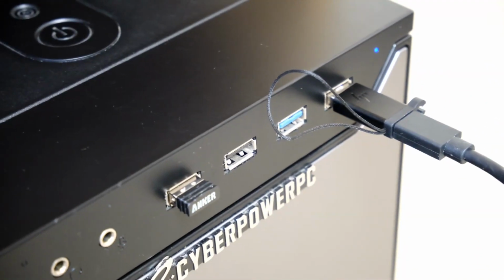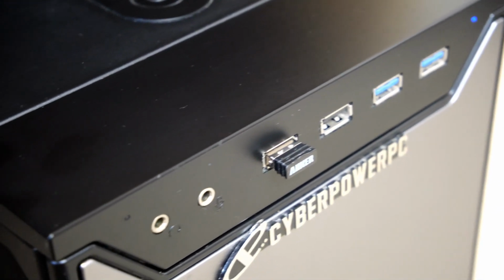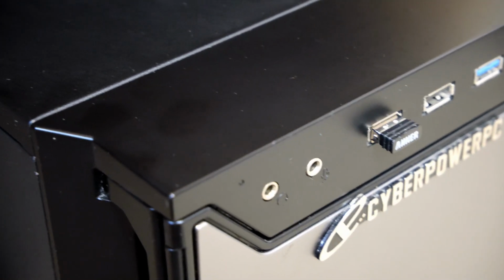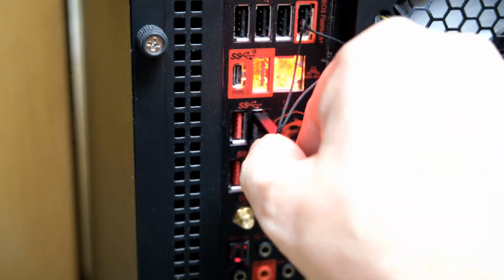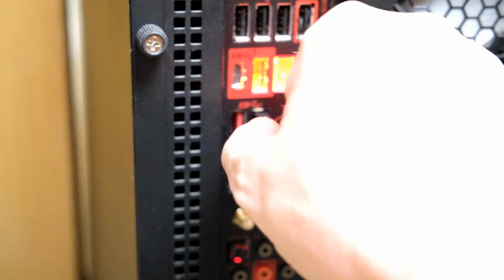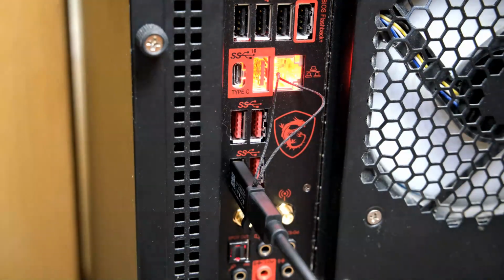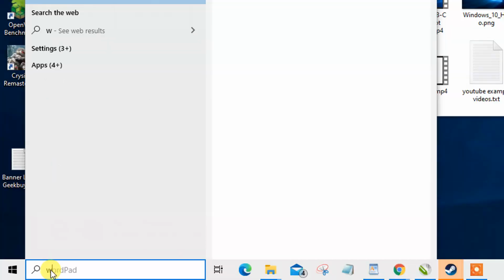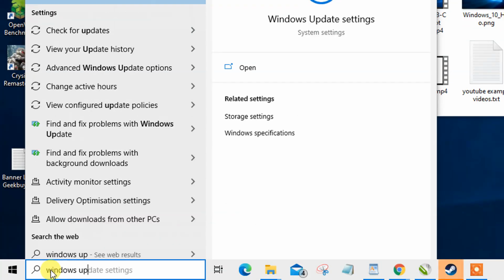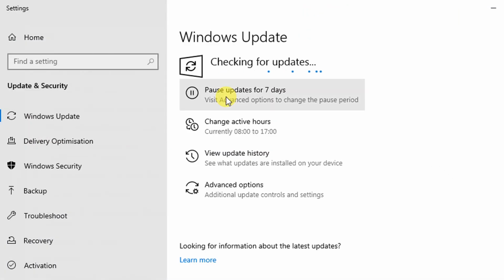You may also have issues if you happen to be using one of the USB ports on the front of your computer. So try using a USB 3 or 3.1 port on the rear of your PC. If you are still unsuccessful, try multiple ports until you find one that works. If you still have issues, and as I recently mentioned, check and update Windows. After that, check that your PC is using the latest USB drivers.